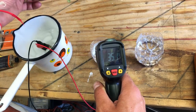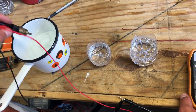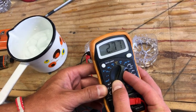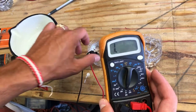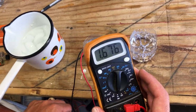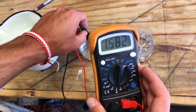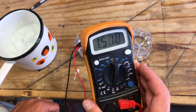The next water is a little bit warmer — 35 degrees Celsius. At 35°C, the sensor should read between 1250 and 1750 ohms. I'll switch the meter one position down for more accurate small numbers — once it drops below 2k you want to do that. Ours is reading about 1450 to 1500 ohms, so it checks out good at this temperature.